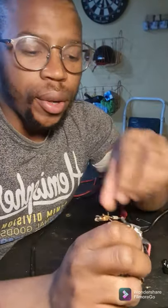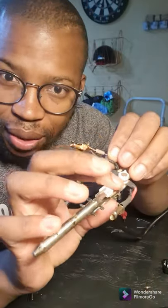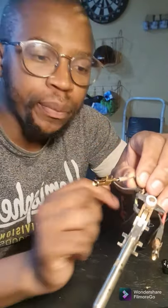I'm back — here's the culprit. This is a thermal cut-off, which is basically a heat fuse. If something gets too hot it burns out so that electricity stops going to the element. What could have happened is that the thermostat failed and the pan got way too hot. To protect the pan, the user, and the electrical line, this thing cuts off the electricity going to the element. It only cuts off at 121 degrees.